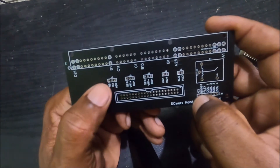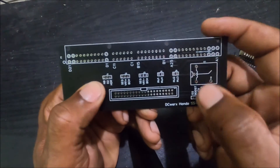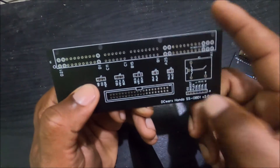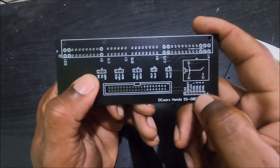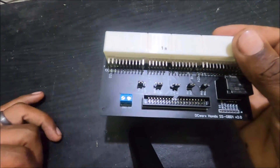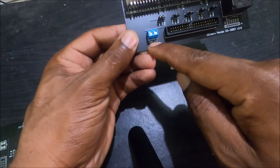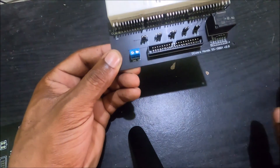In the auxiliary section we have O2 — if you wire in your wideband you can wire it directly here and then set JP12 to HDR, short for header. Your boost control solenoid from the Speeduino wires here — it's a two-wire connection, one end here and the other end goes to switched 12 volts. Your flex fuel sensor input to the Speeduino can be wired here. If you want to do coil-on-plug, wire your coils here accordingly — coil one here, coil two here, coil three, and coil four respectively. The ribbon cable goes to the Speeduino, ground on the left connects to ground on your Speeduino, and 12 volts here connects to 12 volts on your Speeduino — that's all the wiring you need.